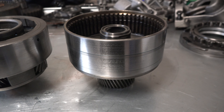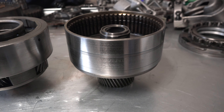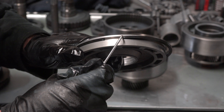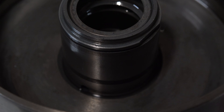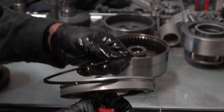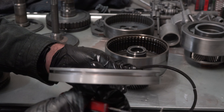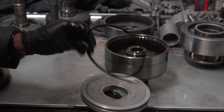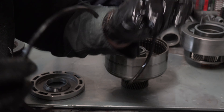With the outside drum surface as good as I can get it, it was time to put the drum back together. I first replaced the O-ring on the piston and the O-ring inside the drum. Both of these O-rings were pretty much petrified — rubber shouldn't sound like that.